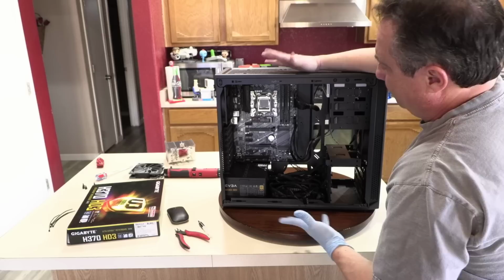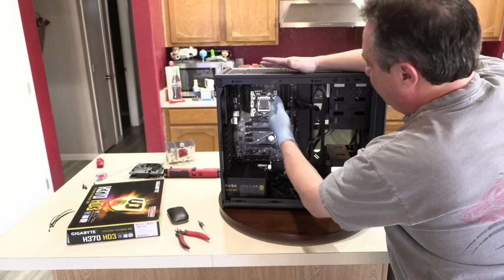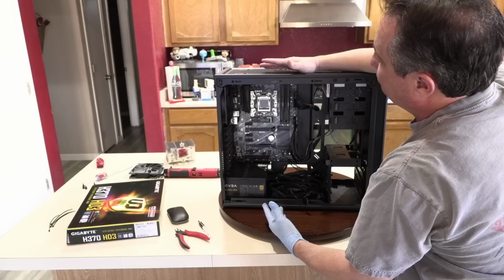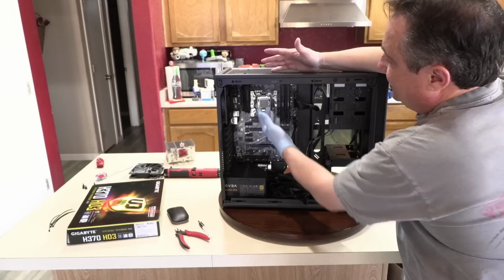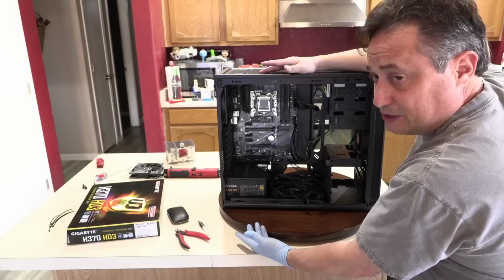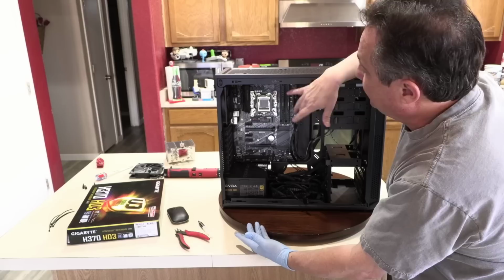There's almost no wrong way to put thermal compound on, if you want to put a dab on there, a couple of dots or a couple lines, whatever it is. It's just important that you put some on there, and if you put too much on, it's messy and it won't work as well. If you put too little on, it's not like you can look underneath it to see, right? Once that heatsink goes on, I don't know if my thermal compound spread out properly or not. If it oozes out the sides, I definitely know I put too much on. So doing it this way, I have peace of mind knowing that the coverage on the CPU is equal and it's not too much, it's not too little.